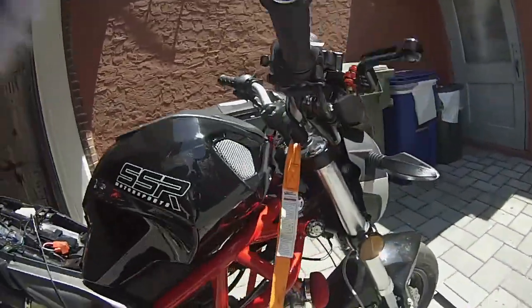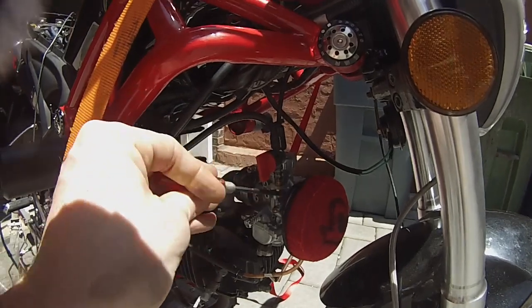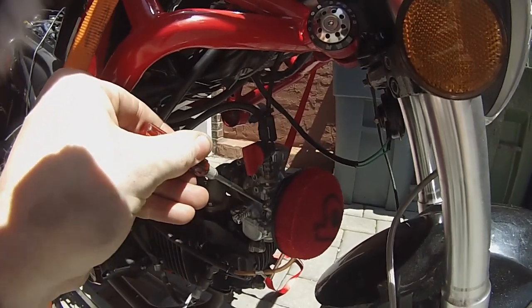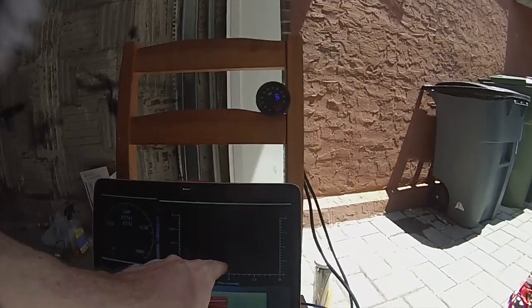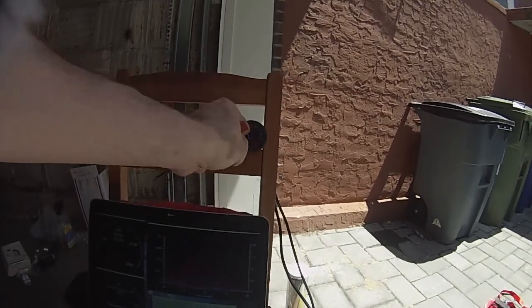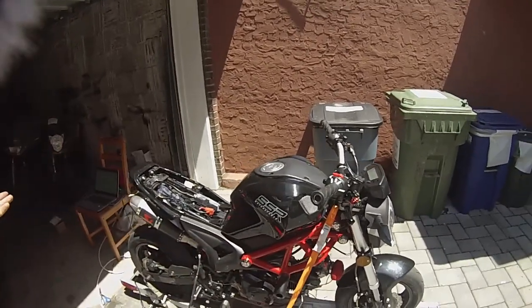So we tune this in the wrong direction — let's go full turn in. That's going to drop our air fuel ratio into the 10s. And now our average power is now below 1.8. So you can see you adjust the fueling to get the most power. And that's how you dyno tune a carb bike.